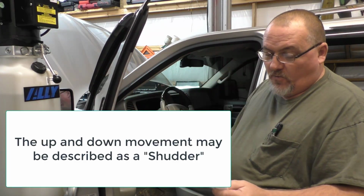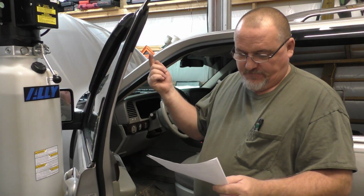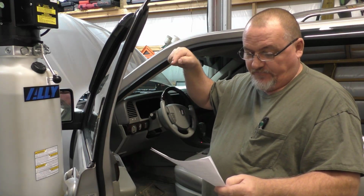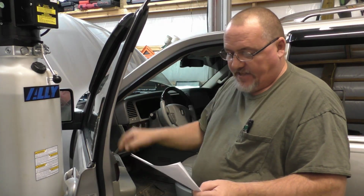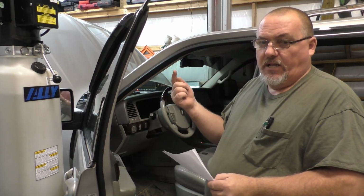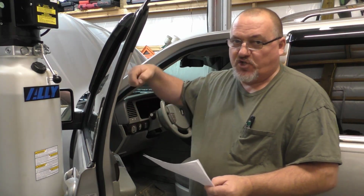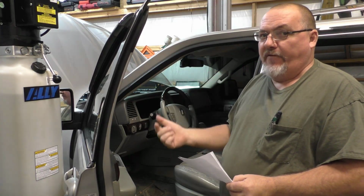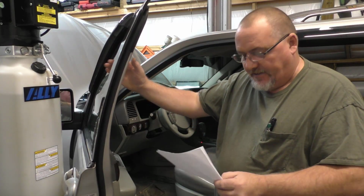Now on step 7, we pull the switch until it stalls in the seal. Then we push the automatic button and let the glass go all the way down. Then we pull the button back up, pulling the glass back up until it stalls in the seal, and keep holding it until it starts moving again. After that, the initialization should be complete. Now let's test that.